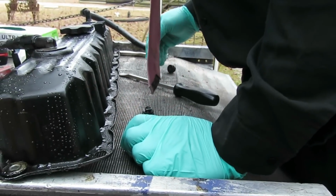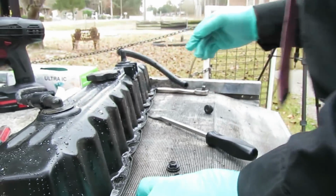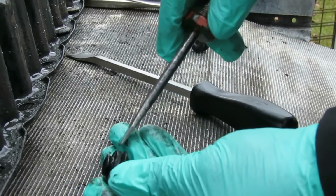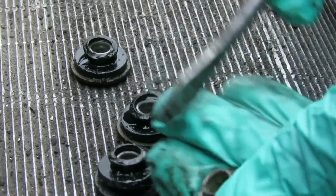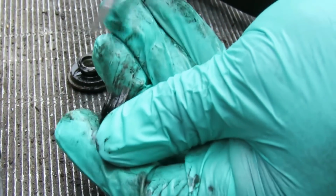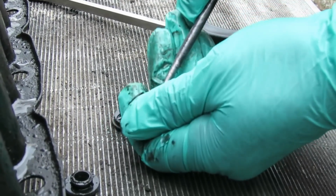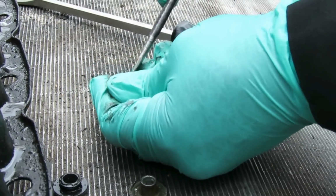All right. Next thing you want to do, this is a little, what the heck, man? Where's this other screwdriver at? I thought I brought this one. The red one? Yeah. All right. So now I got a shorter flat screwdriver. And what you want to do, those little grommets come off of there. So just take a screwdriver, pry it between there and work those off. The only thing I'm doing is a twist action on the screwdriver. And these stop the oil from coming out. You don't change these, and your valve cover starts leaking. You know why.